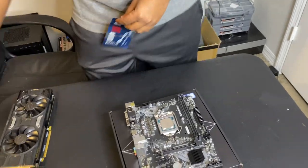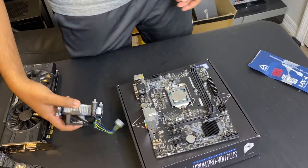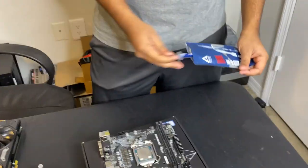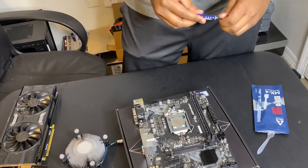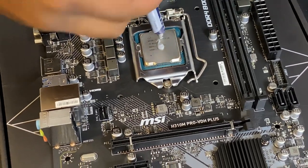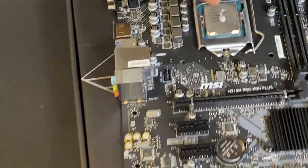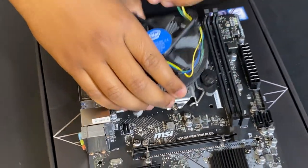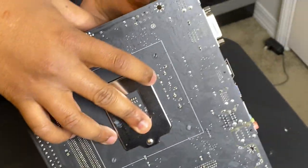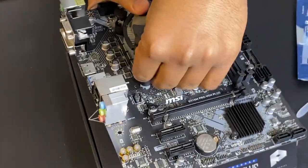Next you've got to put on your cooler. Today we're going to go with the infamous Intel stock cooler because this is an i3 processor — it doesn't really produce that much heat. You can also upgrade with another air cooler; you can probably get an Artic air cooler for around $20. But the Intel stock cooler should be perfect for what we have here today. Let's go ahead and put the thermal paste on — just a rice-size drop, just like that. Then we're going to put the Intel stock cooler on. Any orientation is fine as long as you put it into the holes. Make sure it's on, push down on it, make sure all the pins are on, then push down each tab and turn to the right.